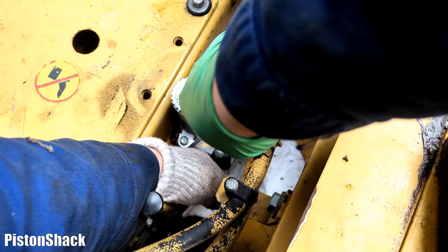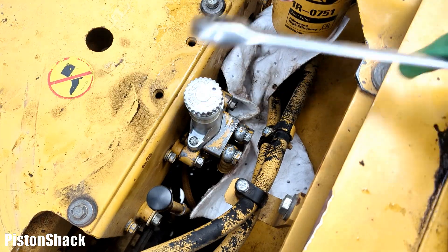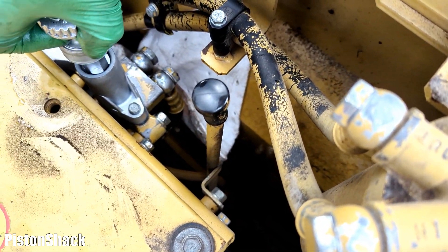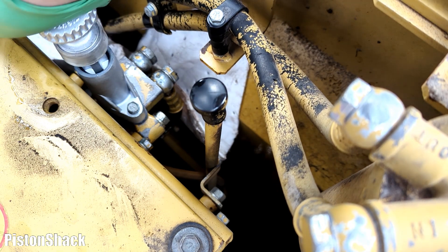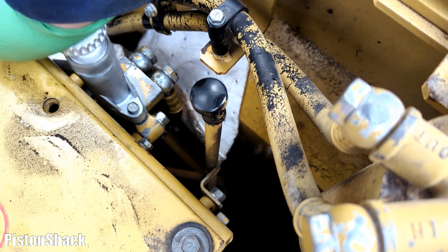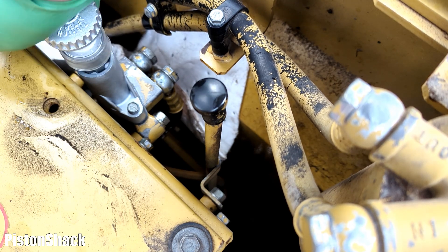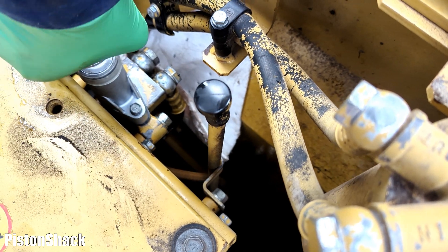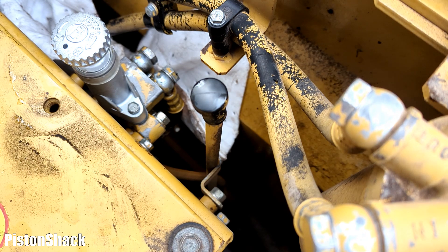There's a copper washer - get it seated. Two filters - everything will get filtrated. Do a few more pumps to prime the system. Failing lift and priming fuel pumps on the low-pressure side are a very common problem. Pump is closed and the cap is sealed.